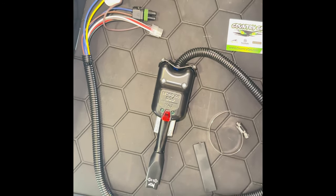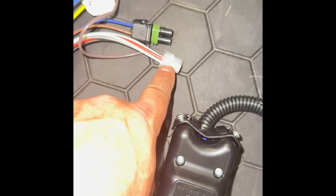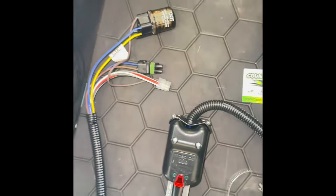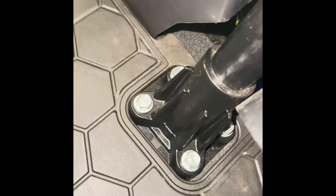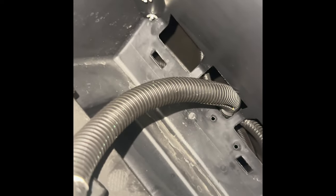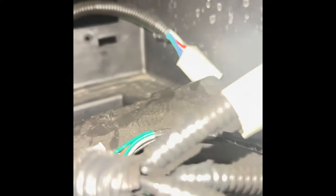Here's the Country Cat turn signal kit. This is how you fasten it to the steering column. This is what's going to plug in for the blinkers, this will be for the horn jumper, and this is what controls the blinkers — those are already wired in. If your dash is like mine, here's your horn. What you're going to do is unplug one end and then plug it into one end — female, male — boom, that's it. Same exact position, same everything. We've got the female end here and the male end, and we're going to run this down the column and up around that little hole on the left-hand side, then poke it right through that hole. Everything fits real nice. This is where the blinkers connect, so just got to disconnect that, and once we run this around, we'll plug that right in — then clamp this thing down and it'll be ready to go.